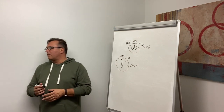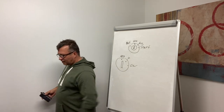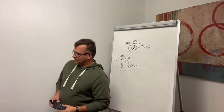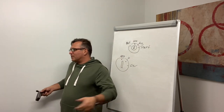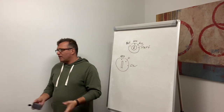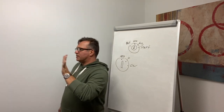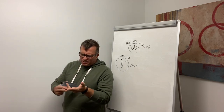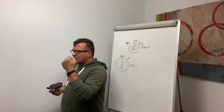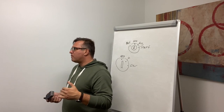Well, let's talk about firing up the engine. What's gonna happen? How do you think? If you just get into the truck, put the key in and fire it up, no. It probably will be expensive. Maybe it will be just a couple of faults, a couple of key cycles will fix it, but in some situations you will be waiting for overseas parts. What happens is there are five different computers on the truck. It's a complicated system: engine managing computer, body managing computer, transmission, climate, and more. It's a lot of electronics. They need time to run self-diagnostics. Okay, before firing it up.